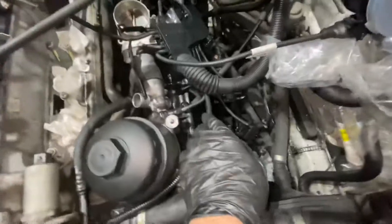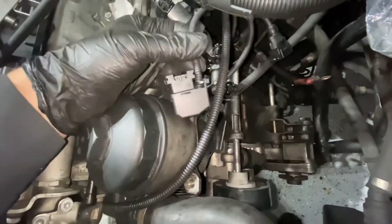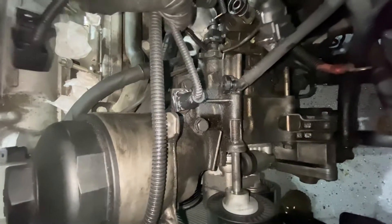Now this lead will go to the final section, which has the most wires. One of them is the big one that connects to plugs one, two, and three. Moving on, this next one plugs into the underside of your intake manifold right here. The third one plugs in right here behind the oil filter, and the next one plugs right next to the oil filter right here — so those two are now covered.